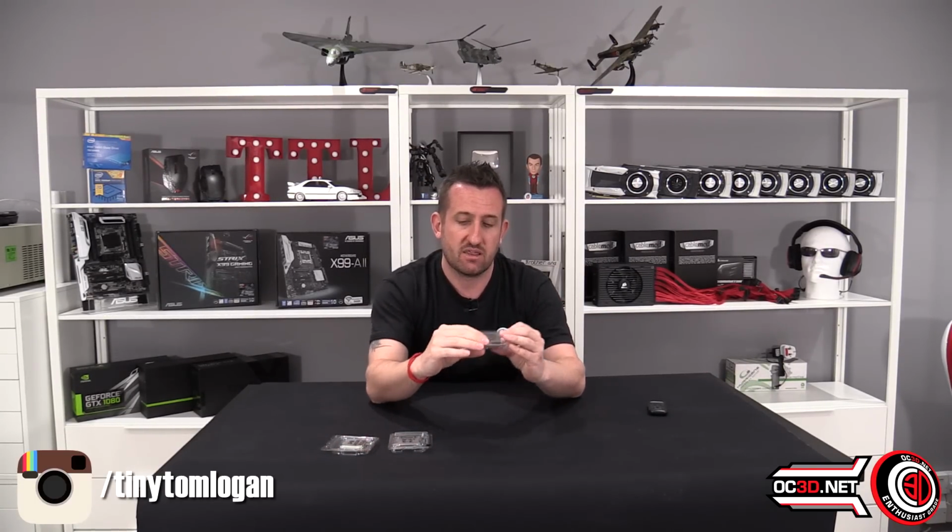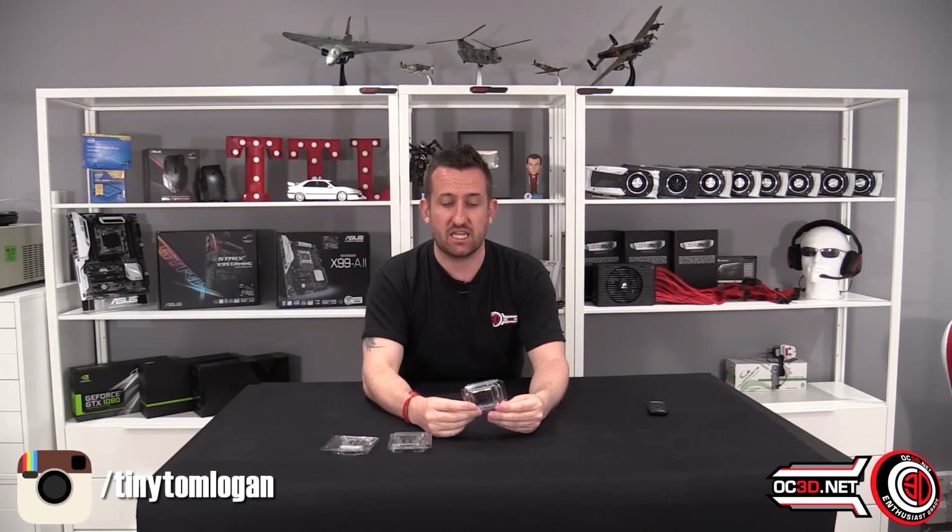Now, the other two, I actually think that if you have to have 2011, and you're looking at dual graphics, because for me personally, if you're going to buy one of these processors and it's a gaming rig that you're talking about, this 6850K is the little jewel in the lineup. With those 40 PCI Express lanes that I talked to you about, that's going to mean that your two graphics cards, no matter what graphics cards you have, whether you have a Fury X or you're running 1080s or you're waiting for graphics cards that are coming later on, those graphics cards are going to be getting 16 PCI Express lanes each. And when we're talking about a gaming rig, which is what I said, that's really the only reason to jump in on 2011, is to make sure that they're being fed properly.